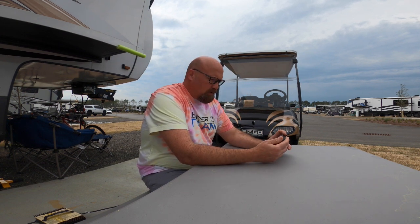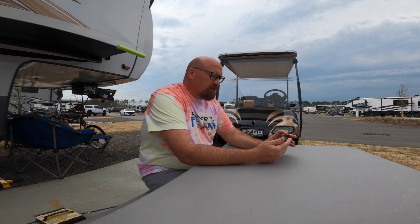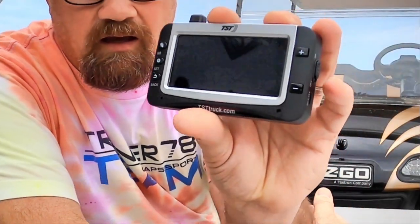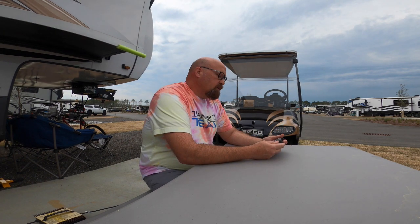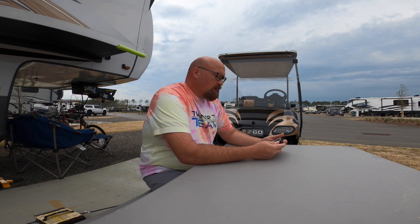Got my tire monitor here, waiting for it to get all the signals from the tires. Looks like I got three signals out of four tires. The pressure is a little bit higher than before because it's warm. I'm gonna let air out of three of the tires. The fourth one just kicked in — driver's side rear tire is at 116 psi, supposed to be at 123. So I've got two tires at 125, one at 123, and one at 116. Let's let a little air out of a couple tires and put some air in one of them.